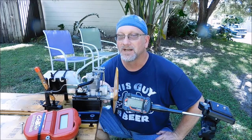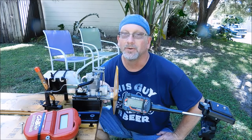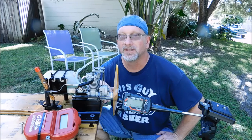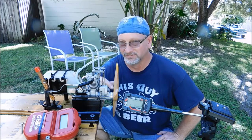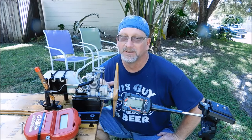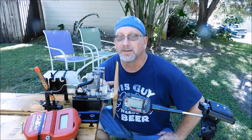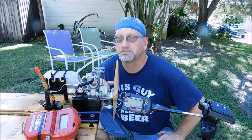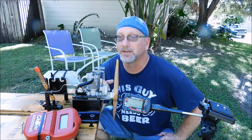My, obviously, my Saito FA-40 open rocker engine with an OS F plug and a Master Airscrew wood 11.6 prop. It's tuned about as good as it's going to get with this alternate carb on here. It's not going to get any better than this. I guess this engine just isn't going to produce over 8,000 RPM with an 11.6 prop. This is the second or third type of fuel I've tried with it. Just won't do it. Anyway, it's a nice running engine.